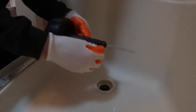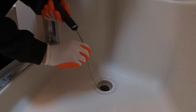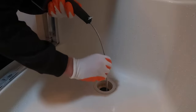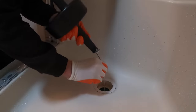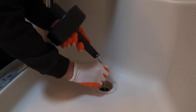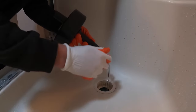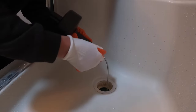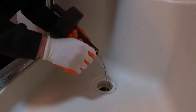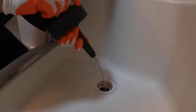So let's turn this off. Drum auger here — you want to open this guy up and feed it down in there. Now see, the water already went away. You want to just keep pushing it until it won't go anymore because there's probably a bunch of debris and hair down there. So once you get it to where it stops, you want to tighten up this little nut. Sometimes there's a little button you push and it locks the cable in place — that's really important. You only want to leave about six or ten inches of cable out.